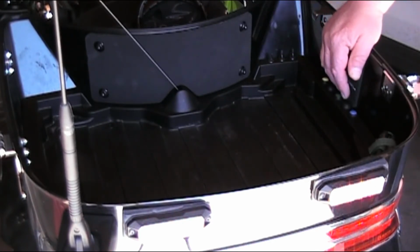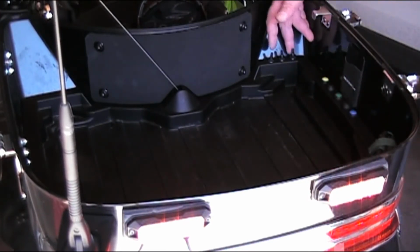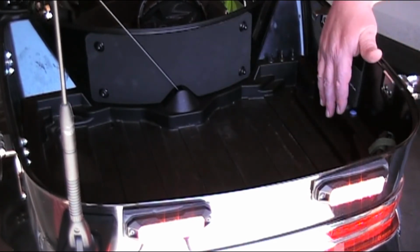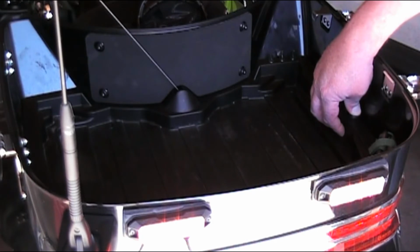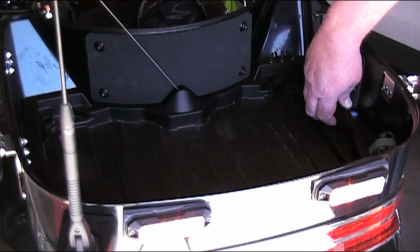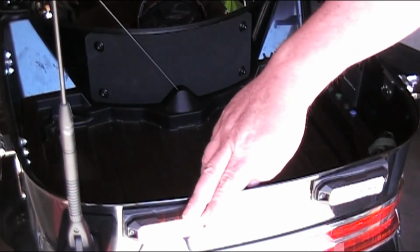The other option would be, now that I've got this, we'll go back solid so you can see them. The blue one changes the brightness to dim, and that is bright. So if for some reason they fell out of sync mode, or I had to replace a light, and even pressing the green button for 2 seconds couldn't get them back in, I would go to the blue mode, change to blue, and then I would push this one to go into group A programming, push the second one, there's group A, now it goes to group B, that's for 5 seconds, turn the power off, turn the power back on, and now they're synchronizing.